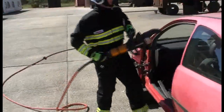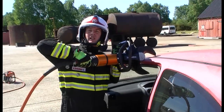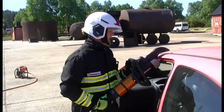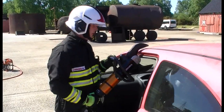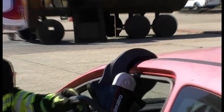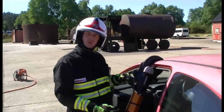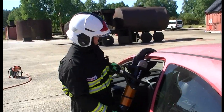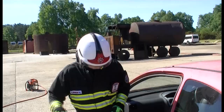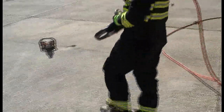Likewise, if I need to put a relief cut into the cantrail, instead of before, trying to get the tool in at 90 degrees, holding it up at shoulder height, which is quite difficult and straining for those that use the tool a lot, I can now come in at quite a nice low angle, much better control, much better visual. We can see there, we're coming in at a really nice angle, which is a lot easier for me to use. Again, don't forget when moving around, seam, cross over the blades, carry the tool by the handle, 45 degree angle, and we move around nice and safely.